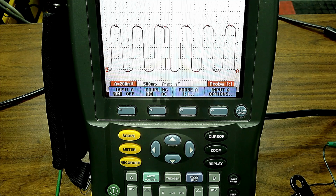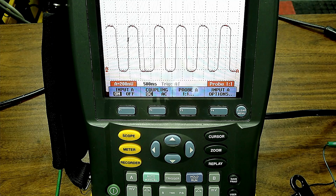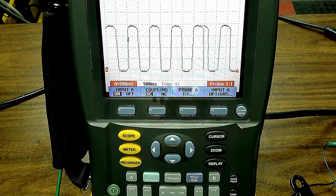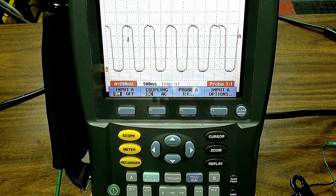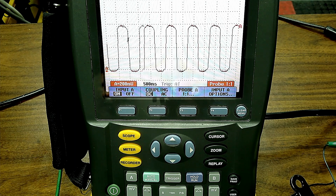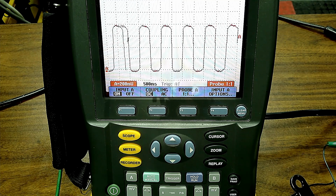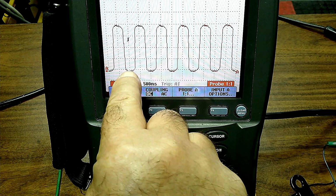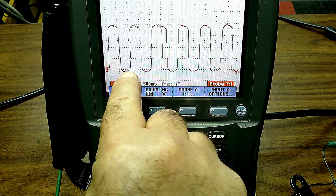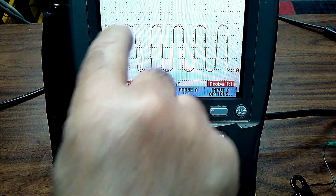So let's see what you got. I'll take another sip of water. Okay, someone said 100 mV. I need the bottom and the top. Good try there, Frank. 150 to 850. Oh, give that man Pete. Is that guy Pete? Yep. 150 to 850, Pete, type your email in there. 150 to 850, meaning we want to at least get to the bottom to 150. It goes a little lower than that. As long as it doesn't go under zero, we're good. We want to at least get up to 850 or higher, okay? But those are the minimum numbers.